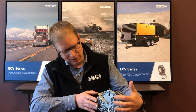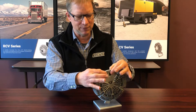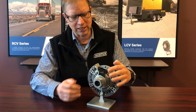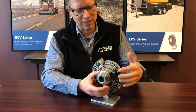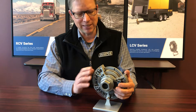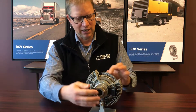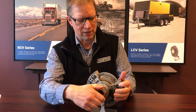So we'll start out by taking a look at this. You have the outer housing, then you have this inner piece. This is obviously a cutaway — in real life this would be a full circle and this piece would be fully contained within. This black piece is where the engine control module harness plugs in to provide instruction into the clutch. You might see this spinning a little bit during my demonstration, but in reality it'll be held solid against the mount. This is an LCV40, which means it's a live center, meaning this is attached right to the engine. So this is the part that's always going to be spinning constantly. The power goes into this nut and then this inner piece is always spinning at the rate of the engine.